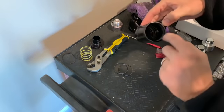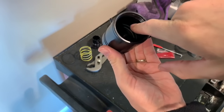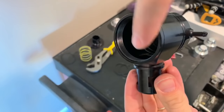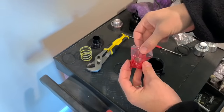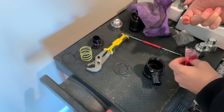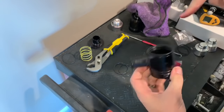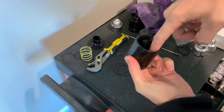Take your new o-rings. I got the bottom one in — now there's another one that goes right around here, do the same thing. You'll see the two new o-rings seated right in there. Now we'll go ahead and get some grease — get it all around where those gaskets are, and cover the whole internal wall of the diverter valve.